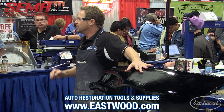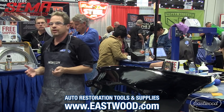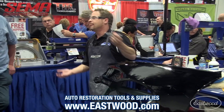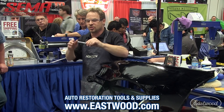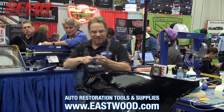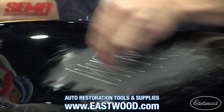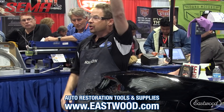Just like when you're using a guide coat with your primer surfacers, you can use a guide coat with your clear coats. I don't recommend the spray guide coats because they'll wash off the panel. A good friend of mine, T.C. Pennick from Bay One Customs, turned me on to this trick — and Tim Strange uses it as well. This is a silver Sharpie — a permanent ink marker. There's my guide coat. It's not going to damage the paint — it's a catalyzed, cross-linked clear coat, and it costs about 50 cents a piece.